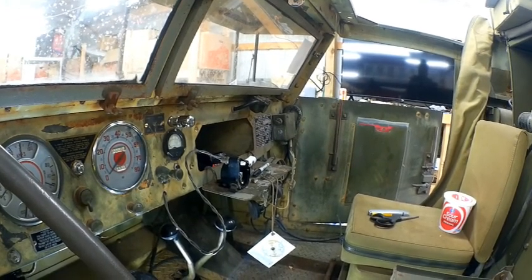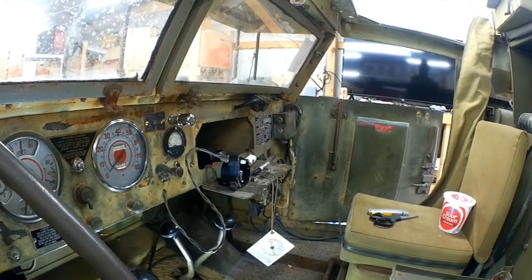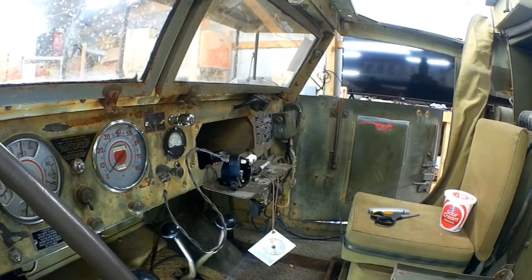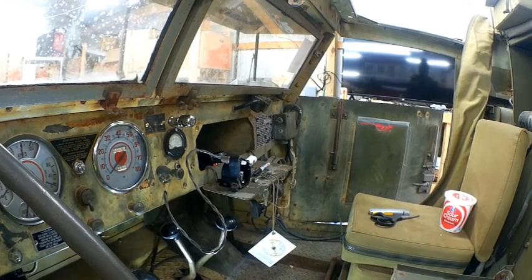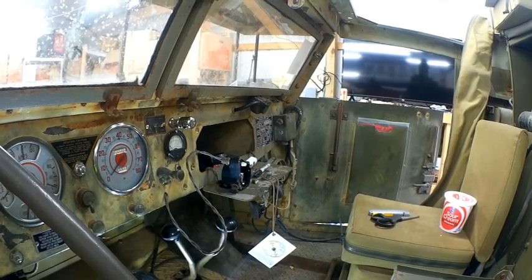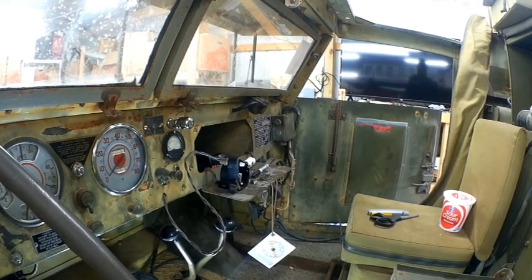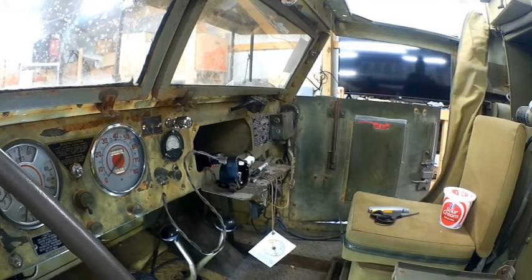So wish me luck. I'm going to have to use a Dremel tool, and cut the top off the plastic case, carefully drain all the product, and then pull the compass itself out of there, clean the mounting all back up and put it back together, and then fill it again with a product, which probably will be... I'll have to check. I do have the original book. It may give me a clue what they put in there.